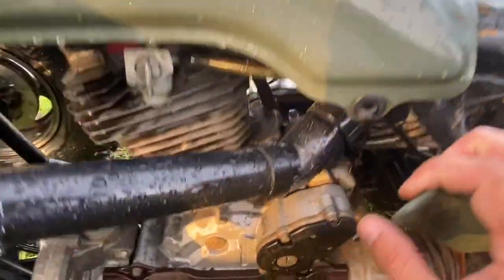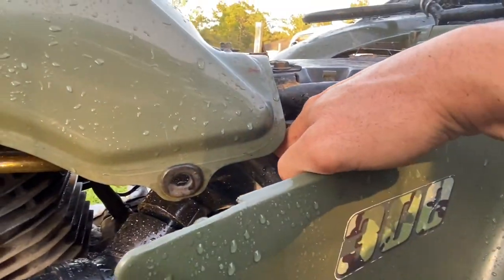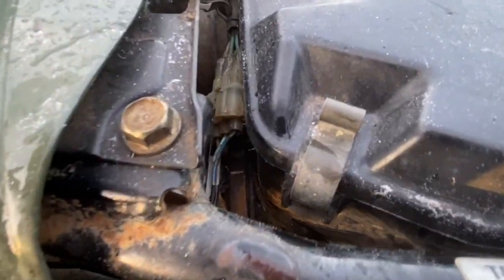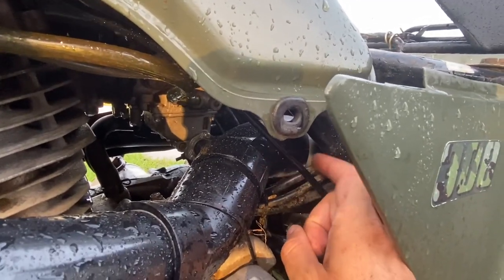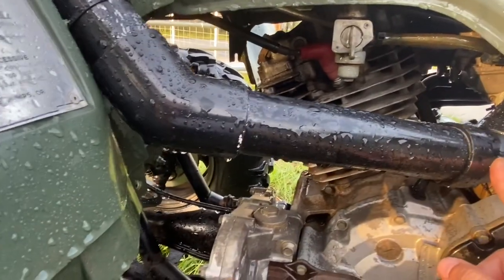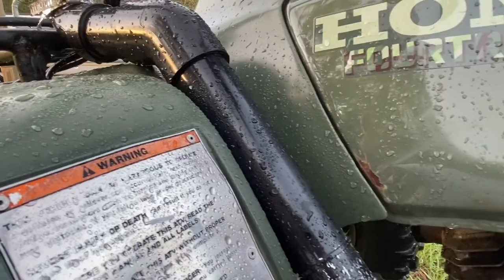I'll put a list of exactly what you need in the description. Basically there's a fitting that goes into the airbox — a one-and-a-half inch to one-and-a-quarter reducer — and a clamp tightens around that. I RTV'd it for extra sealant. Then you have a 45-degree PVC that comes off that, connects to another 45, with a straight piece about three to four inches long connecting them. There's another straight piece about 14 inches long connecting to another 45 connector, and then another straight piece connecting to a fourth 45 — so four 45s total.